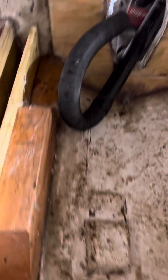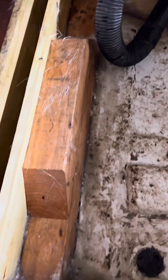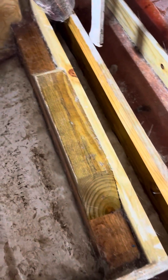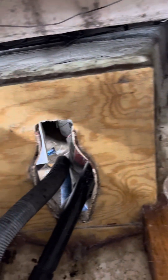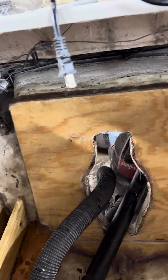That's where I'm currently at. The transom and anything back here will be wrapped more than likely around three to four layers — one, I want the structural strength for the engine, so that when it sits on these mounts we're good there, and two, anything that can get water intrusion you definitely want 100% waterproof. So the transom will get about three more layers, making it a total of four. This side will get three to four layers. The bulkhead on this side will also get three to four layers. This one will get just another section of cloth, and this one will get a section of cloth as well.